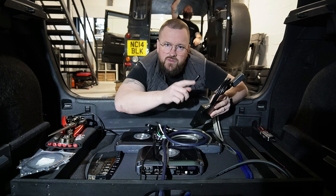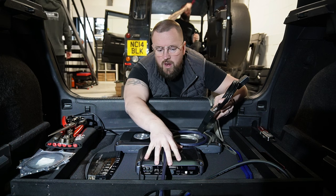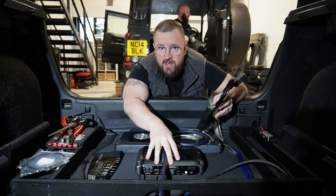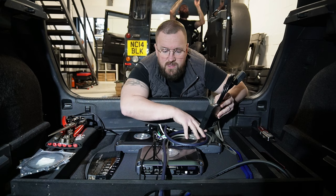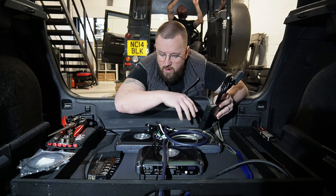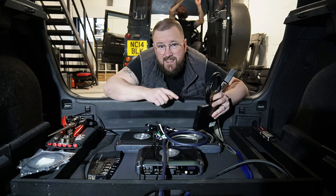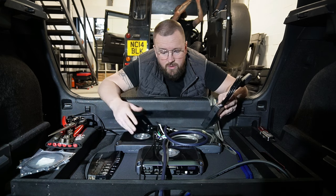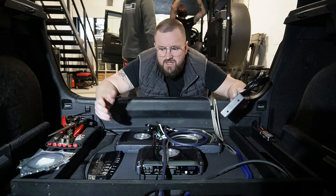What I was thinking was that I could go high level into the VXI amplifier, and since it's being converted from analogue to digital via DSP, it would give a fibre optic output I'd plug into this and send fibre to the rest of the amplifiers. It doesn't seem that's what I'm going to be doing. So what I've got to do is go high level into the first one, use the pre-out from the master amplifier to the analogue input on the slave amplifier — the 404 — and then use the pre-out from that amplifier to the mono amp. That's a daisy chain configuration, so no issues really, just different to how I expected.